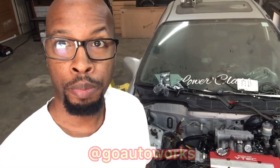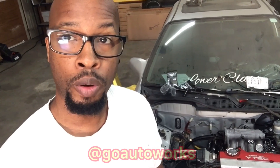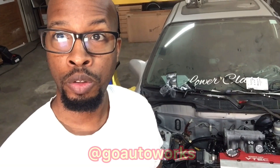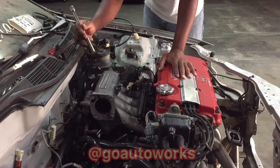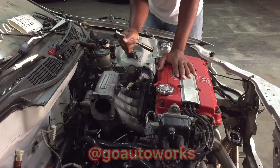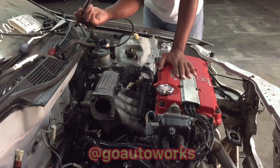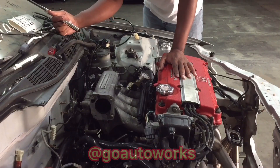Hey, I'm back with the Civic. We had a slight change of plans since doing the throttle body upgrade last time, so what I'm going to do now is pull the intake manifold back off and show you what I got lined up. We decided to go ahead and do an intake manifold upgrade. Pulling the intake manifold isn't difficult at all, especially since the car hasn't run so there's no coolant in it — it doesn't even make a mess. All it is is the 12s. Use a 12 millimeter wrench across the top, 12 on extension to get the ones across the bottom. Pull all those off, disconnect the coolant hoses, and the manifold pops right back off.